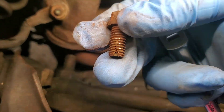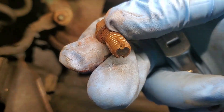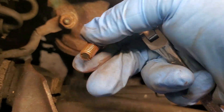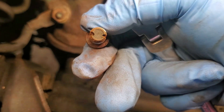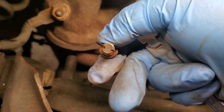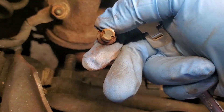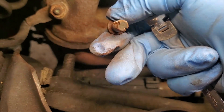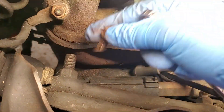You can see it traps all the junk and trash that was in that hole — it's all packed in there. Four slits would be even better, but generally I find two is good enough to get the job done. Unless there's a lot of nasty crud inside, then you might need to clean this bolt out a couple of times before you can run it all the way through.